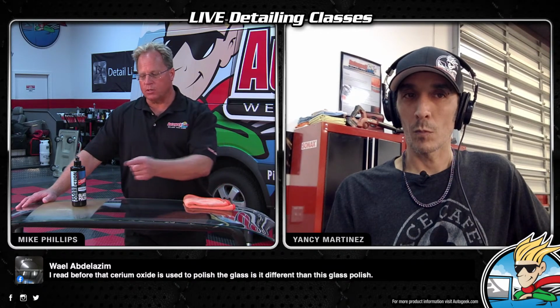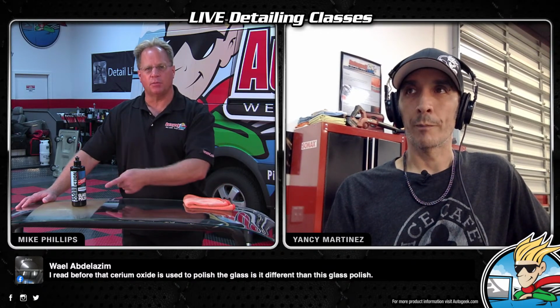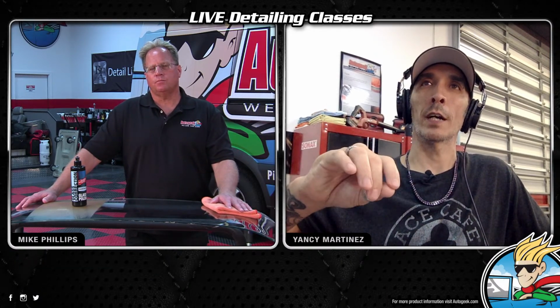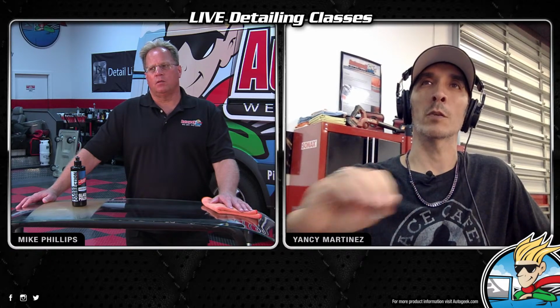While comes out, I read before, the cerium oxide used to polish the glass is different than this glass polish. Yes, these are totally 2 different things. 2 different abrasive technologies. One is for subsurface defects like wiper marks, pits, and scratches. One is for topical stains or buildups, film buildups. Could you say that one has grit harder than glass and one softer than glass? Because one would have to be a little bit harder than glass in order to abrade it, would it not?